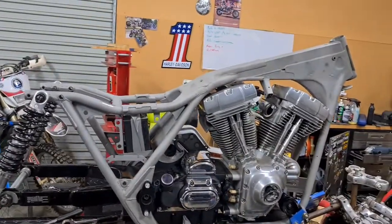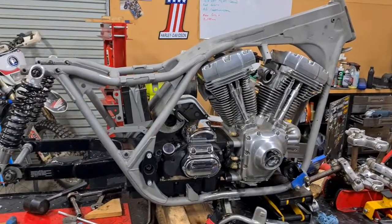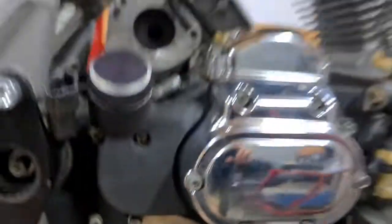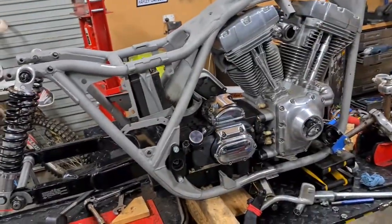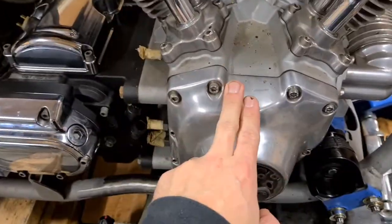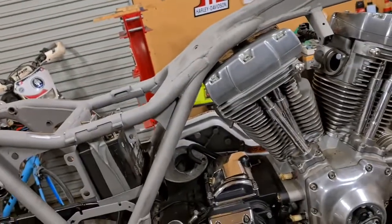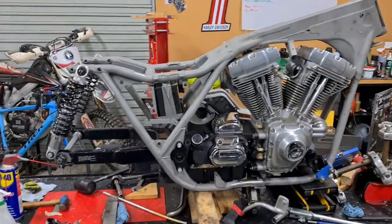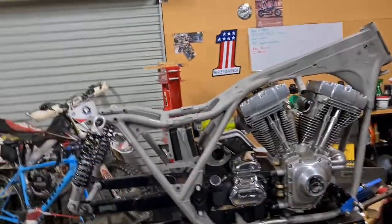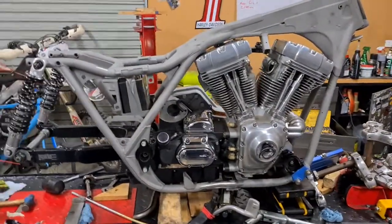This bike started life as an '86 FXRS, but it was completely haggard when I got it. The poor bloke tried to rebuild it himself, punched a hole in his transmission - used the wrong length bolt and punched it straight through. He rebuilt the motor apparently, but when I pulled the Evo cam chest cover off it was all mistimed. It did have fresh bore, it had obviously been bored out, but I just didn't trust the rest of it. So it's sitting on my bench as decoration until I can go through it and see if it's worth salvaging. That whole drivetrain was unusable.